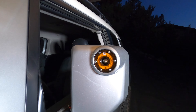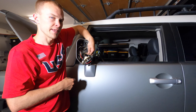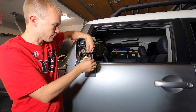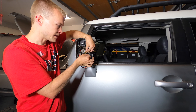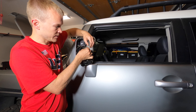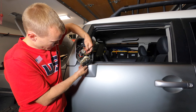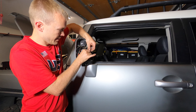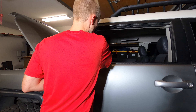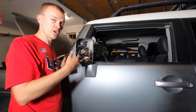Next, we're going to go ahead and cut these wires off here for the old light fixture, and then we'll want to strip the plastic off of the ends to get the copper showing. Now we've got to connect our positive and negative with positive and negative here. Unfortunately, Toyota uses yellow on both of these, so we don't actually know which is positive and negative — so we're going to take a 50-50 guess. We'll start by twisting these together, then we'll confirm we're connected correctly by reconnecting our battery. If it doesn't work, we'll swap them. We're getting light on the passenger side but not the driver's side, so it looks like we were off on our 50-50 chance. We'll disconnect the battery and try the other side.